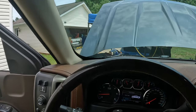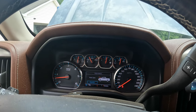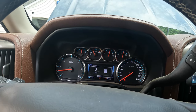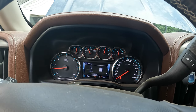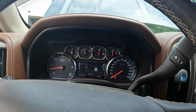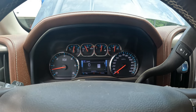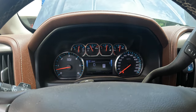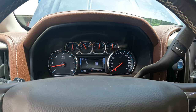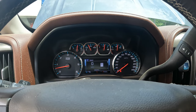I wanted to tell everybody: there is a class action lawsuit going on right now with this truck. The AC compressors tend to crack, which is what causes the freon leak. So keep all your receipts — I'm giving the owner receipts for parts and labor so he can get his money back once the lawsuit is settled. I believe it affects 2015, 2016, or 2020-2021 model years — I'll look it up and put it in the description. Just keep everything on record and you should be able to get your money back.